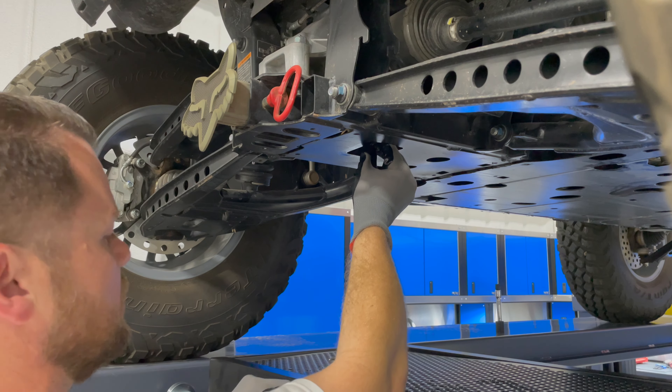If the car were on the ground, I would probably roll it a little bit just to maybe turn the gear in there. Basically it gets to a point where it's blatantly flowing out at every pump. Clean up your drain bolt the best you can. Don't forget the washer. Book says to torque to 23 newton meters.